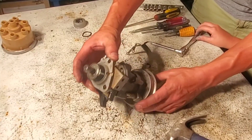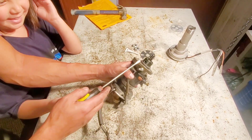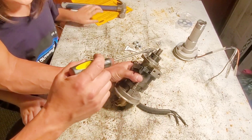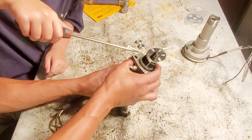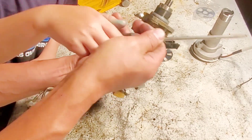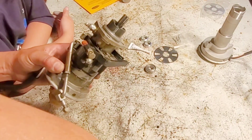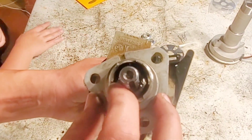So now we just have a plain distributor. Now we're going to use the screwdrivers — not the hammer. There is a ball bearing right here that you need to push up. Push it all the way up on both sides. Now that it's cleared, we have the old trigger here — it's oily. That's out. So now we're at the toughest part, which is the nut right here. This thing can be a pain.